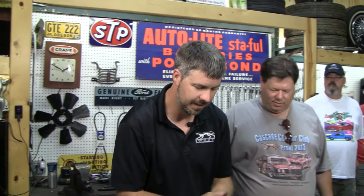Some people just want to do everything at once, and then they know they're good for another 40 years and 100-some thousand miles. But anyway, don't go more than a half turn, a quarter and then a half, because what we've got inside there is worn gears. This is what your slop looks like as you're going down the road. And by adjusting it, you're taking these worn gears and pushing them closer together. You're not really fixing anything, it's just a remedy.